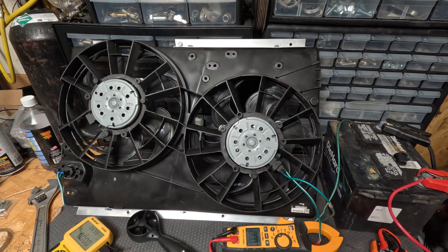These are totaling out about 3,000 CFM with 95% coverage over the radiator, which is a small core anyway — it's 24 by 16. You can't fit much of a bigger fan. If you went to a slightly larger, wider radiator, you could maybe fit a couple of 14s like the Camaros, Chargers, and Challengers use. There is one really high-grade fan — Delta PAG — but those are about $400 each without a shroud, so it's a lot of money to gain a few more hundred CFMs.